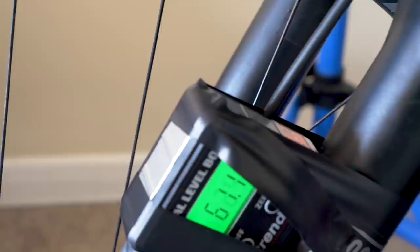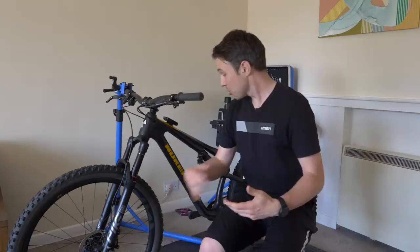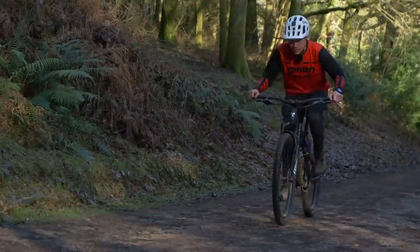Keep an eye on this inclinometer which I'm going to attach to the fork. I'm going to cycle it through the rear wheel travel and you're going to see how much that can change. With a shorter stroke length, even at bottom-out the bike won't be going to such an extreme place — and that affects everything: head angle, trail, bottom bracket height. That is why it is so vitally important that you set up sag correctly. It's worth noting that as the fork compresses, it steepens up the angles, so they can largely cancel one another out. Pedal efficiency is also relative to both sag and stroke length, which makes it such an interesting thing to explore — a shorter travel bike will pedal more efficiently than a longer travel bike because it's relative to sag.